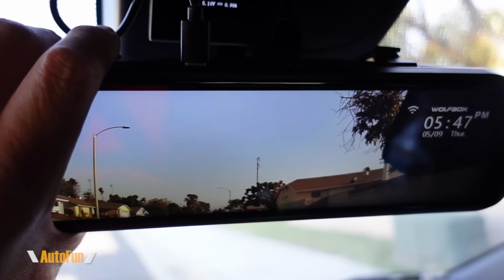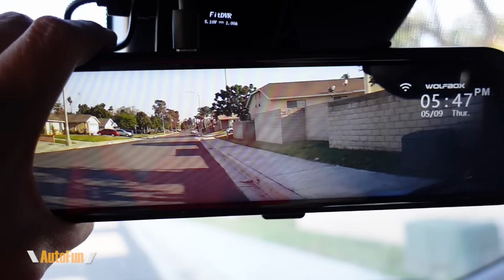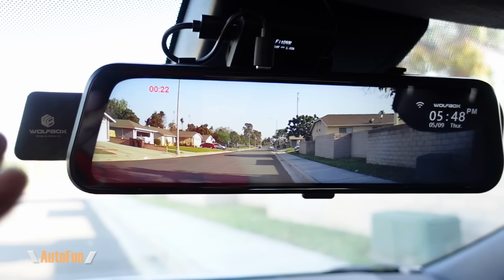And you can see up there the updated numbers, 5 volts, 1 amp. Again, because this is a larger dash cam that has a larger requirement than the prior dash cams I showed you earlier. But now let's move over to test out the 12-volt output for those that have 12-volt dash cams or something like a radar detector that runs on 12 volts.